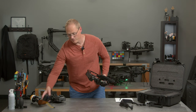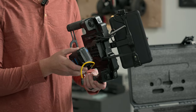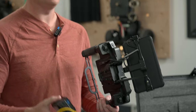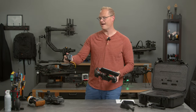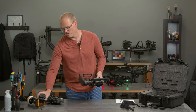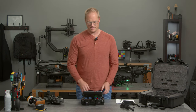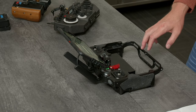We built this one to have very fast and powerful internal batteries. Additionally, if you're doing operations where you need to go constantly, you can attach this little micro V-lock to the back and add it as power. Then you have the ability to just hot swap batteries as needed for as long as you want. The internal batteries act as a buffer. External batteries — tiny, compact, can travel with them — power the thing for as long as you like. Really robust powering setup, which was sorely lacking in some past solutions.